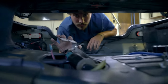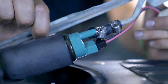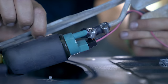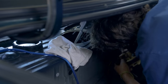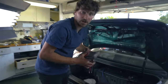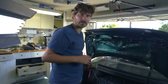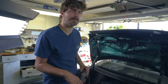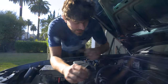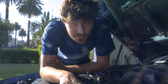You see that hose? That should be all the way down on this little outlet here — instead, it's blown off. AKA not going to make much fuel pressure. AKA our problem. So basically all we need to do is jumper our relay to turn the fuel pump on, go to the front and see if we've got fuel pressure. Hey — 44 PSI! That's what you want to see. We've got fuel pressure, which means this thing should start pretty easily.